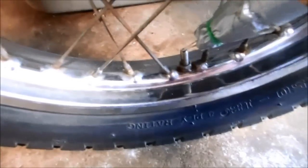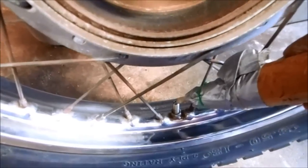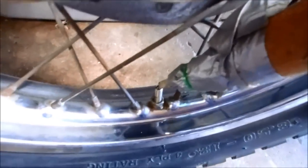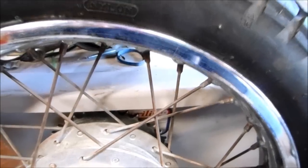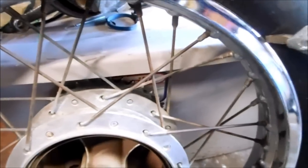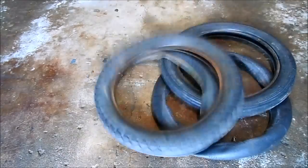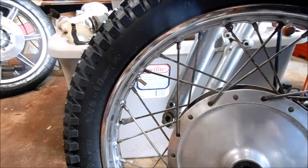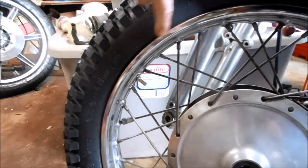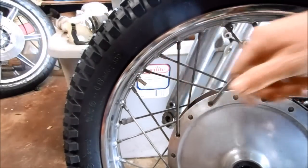With the wheels off I just have to let the air out so I can change the tires. To take the tire off, just use a flat blade screwdriver to pop the bead and then start prying it off. After you pop the new tire on, make sure the bead is seated all the way around and then fill it with the proper number of PSIs.